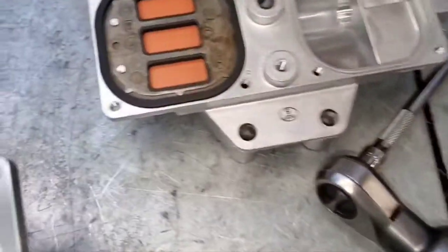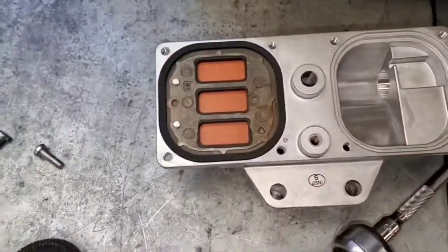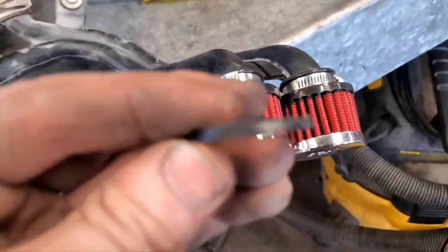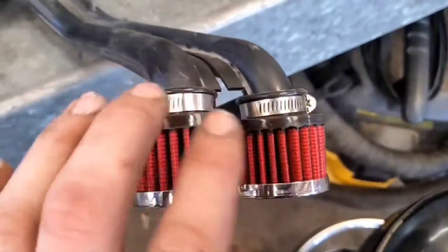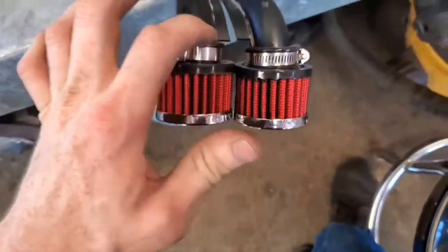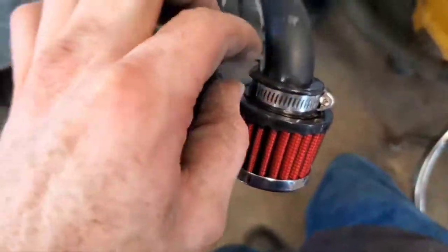When going back in with the new valve, make sure the valve plate faces the front of the truck and the screws face outward on both of them. Here are the two filters clamped on — they came in one inch inside diameter. Don't cut the cone off, just cut a little of the flare section — these filters have a pretty squishy base so you can expand them over the flare. Clamp on the smooth part so it cannot pull off. Slice it down far enough to spread it, and there was one small section I cut out to push the filters up into that location.